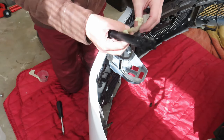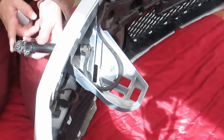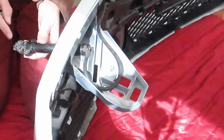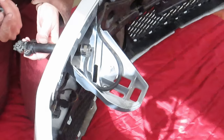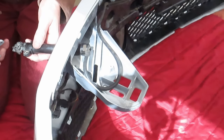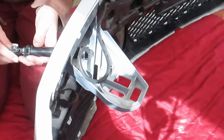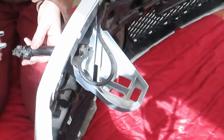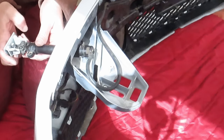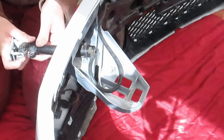There were three screws that are taped to them using this tape, so I know exactly which size screw goes with what. So you'll notice that this thing is angled, and the angle, it's got an L on it. The L must be facing up. You can see there are your little jets. And make sure you install it the right way up and that you don't install it with your jets facing the wrong way around, because that'll be catastrophic.